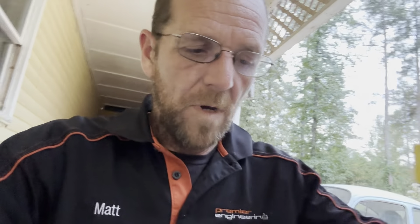We're getting back to working on this Lexus. I've been racking my brain for the last couple hours trying to button up the last little bit of wiring — I've got like six wires left to hook up, and then wire in the rest of the transmission emulator, which I've got most of it wired up. I've got it wired straight into the ECU connector. These are all the wires for the resistors, and I just have these last couple power wires and park and low wires that have to be hooked up. We've been working on making a bracket for the resistors to mount, so that we don't get any check engine lights for the transmission being manual instead of automatic. We're going to drop this motor in here tomorrow morning — 100% guaranteed. I'm really freaking excited.